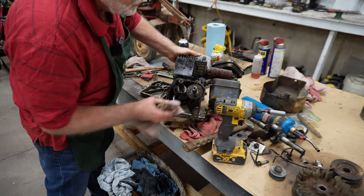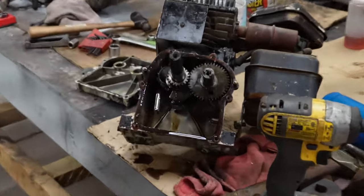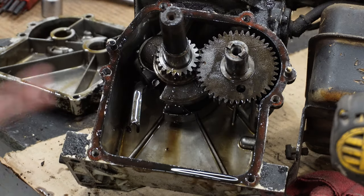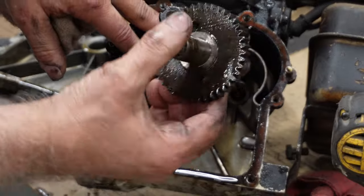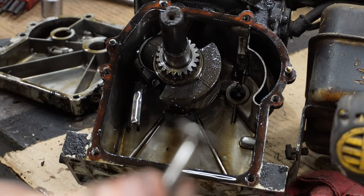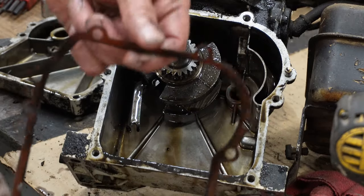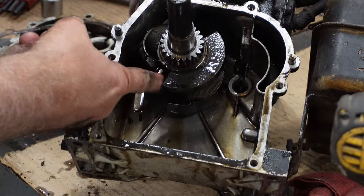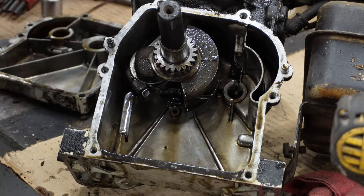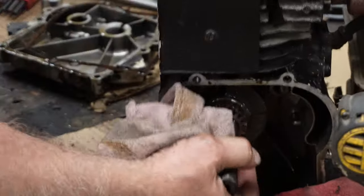Now I've got these two timing marks on here. They're hard to see, but there's a line here and a dot there, so this can come out. I just need to put those timing marks back aligned when I reinstall. The lifters popped right out of there and the gasket is intact. Now I've got to get inside here to take the cap off the crankshaft so I can drop this out of here. I'll probably have to take the head off too to get it high enough, so let's do that next.